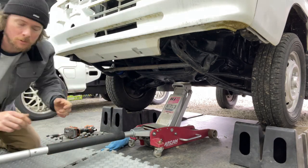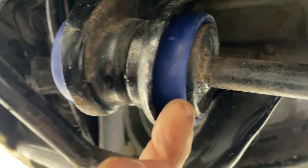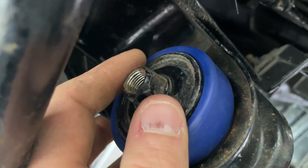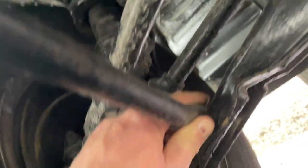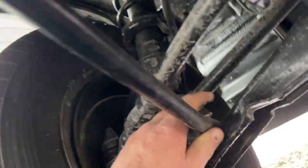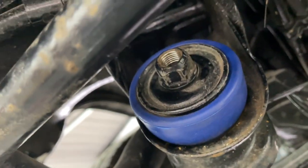Okay, so I've never done this before, so we're learning together. I got the short bushing sitting in the cup in the back, and then I have this bushing here with the old washer. What I'm going to do is tighten that down to compress these bushings, and then once it's compressed and pulled forward a little bit, we can run the bolts back down through — since they're not exactly lining up right now.